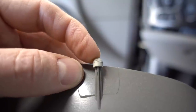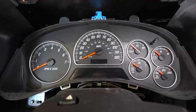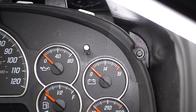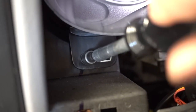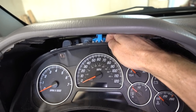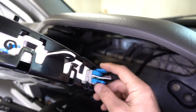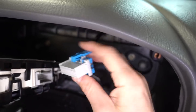One quick note: make sure not to lose these little rubber end bushings that go on these tabs. Now we can see the bezel-less cluster. We can see the blue electrical connector right there at the top center, and there are also four seven-millimeter screws we're going to have to remove. I've now removed all four screws — two here and two on the other side — and this bezel is ready to come out except we have to remove this electrical connection up here. I've pulled the bezel out and you can see this clip here. Just press the blue tab and pull the clip to remove it. This cluster is now free.